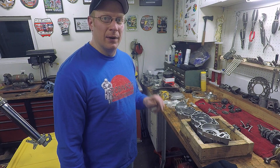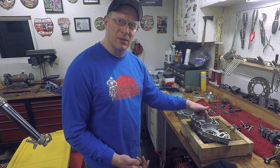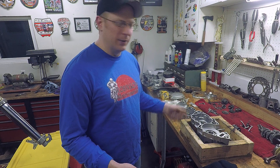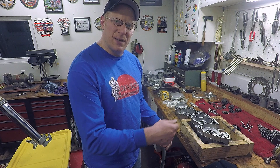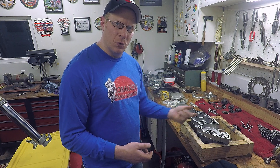I apologize — I definitely wasn't recording when I was installing these bearings. Basically all you're going to do is freeze the bearings overnight; mine were in there for about a week and a half. Then you take a MAP gas or propane torch and heat up the cases — you can bake them too at 350 for an hour or two. Heat them up so the aluminum expands and the steel of the bearings contracts, then you can just drop them in with your finger. You might have to tap them here and there but it's really not that hard.